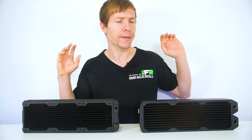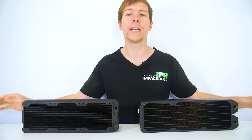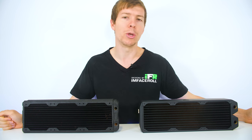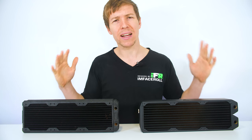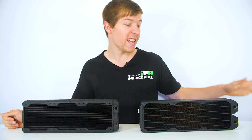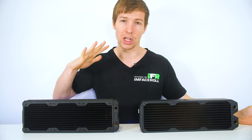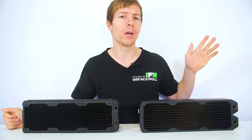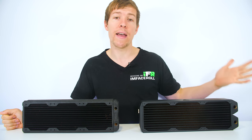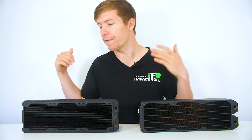If you're just going for a simple loop, then certainly look at these lower FPI radiators — it's plenty of cooling for a CPU and GPU loop. Now, normally when you buy a case, you are given a couple of fans with it. Those fans are not really good for using on radiators — they're just the cheapest stuff. So when you're out on the market searching for fans, you want to look at the static pressure or the airflow, depending on the type of radiator and the fins per inch.